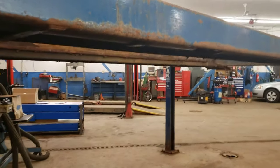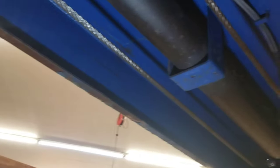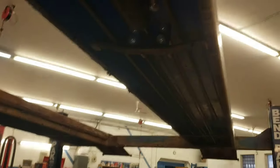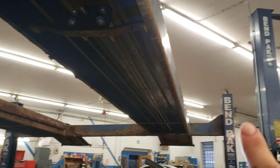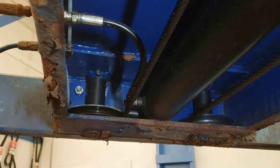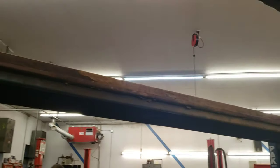I got the hoist all the way up in the air for folks that don't know how a hoist works. You can see the hydraulic cylinder that pulls on the cables. They run through a system of pulleys, and that's what's used to lift this thing up. We got about a 6-foot hydraulic cylinder underneath here, and you can see the pulleys go to each post. This is a floating ramp style, so that ramp can actually slide all the way over and touch the other ramp if you want, so you can adjust for different width vehicles.